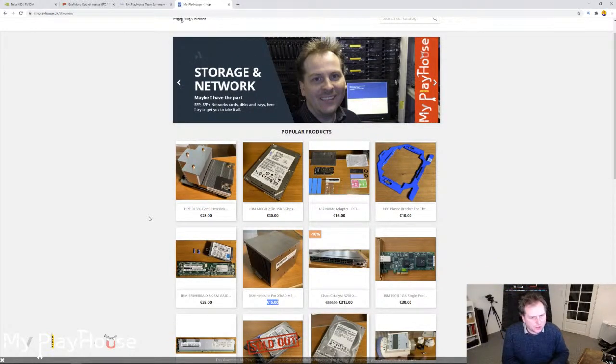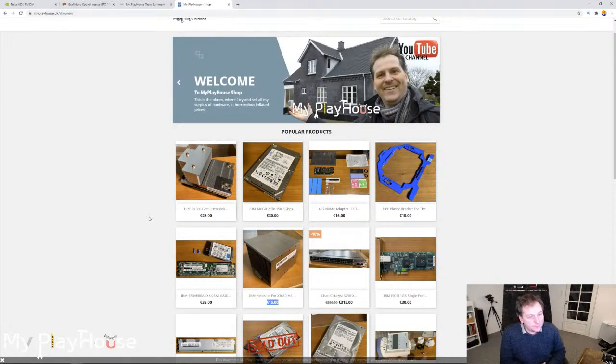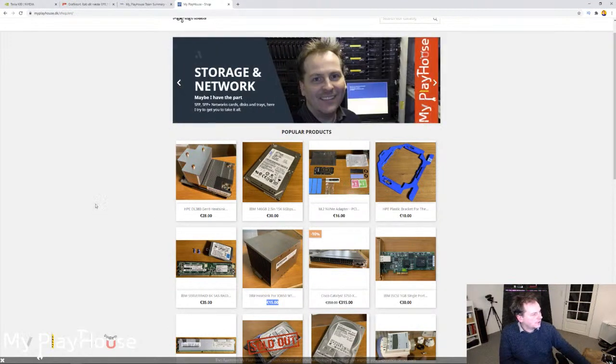Especially I bought some in copper because it was for the X3650 Model 2 and 3. The standard heatsinks that come with that server are for 95 watts, and if you want a processor that can do more than that, you need the heatsinks that can do 130 watts. That one is a bit more rare, and it's made out of copper, and yeah, they charge you. I do believe that heatsink was at least the same price as the processors. But it made a good video.